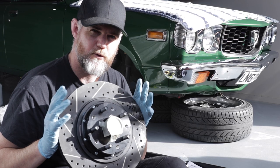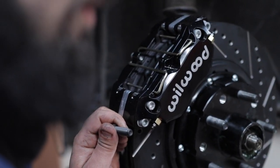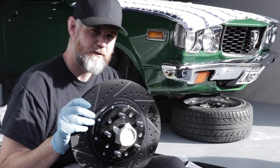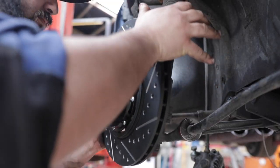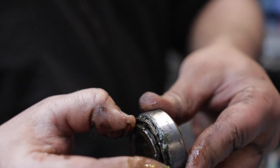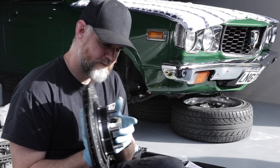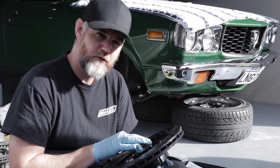A few months ago, if you recall, we had one side kind of mock fitted. There was a bit of an issue with the bearings. The ones that came with the pack kit assumed we had RX3 stub axles, but Blair's had early model RX7 ones, so the bearings didn't fit. Andrew managed to figure it out and we got the new part number, so Blair now has those bearings. We've taken off the brakes from one side and we're going to get the new bearings put in.